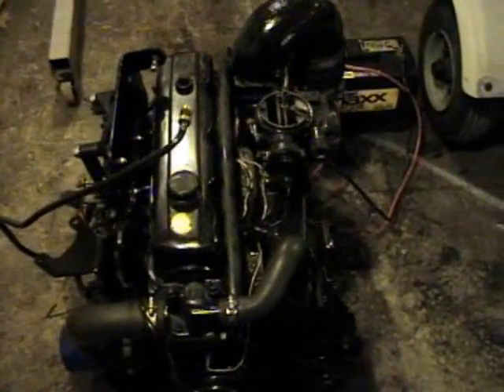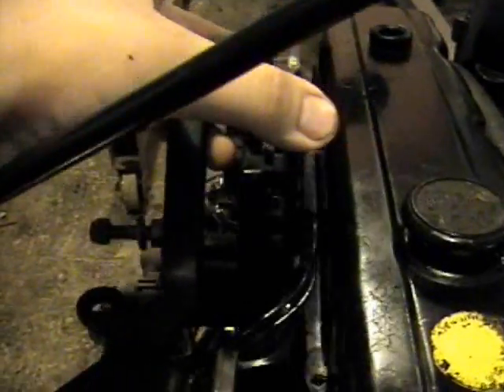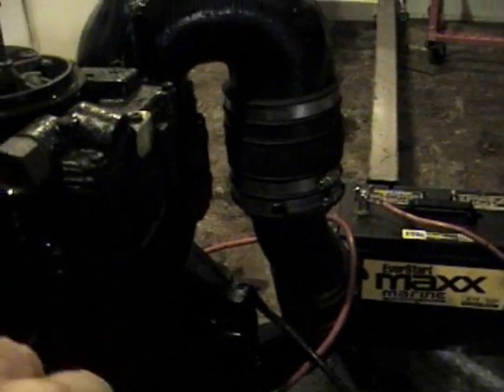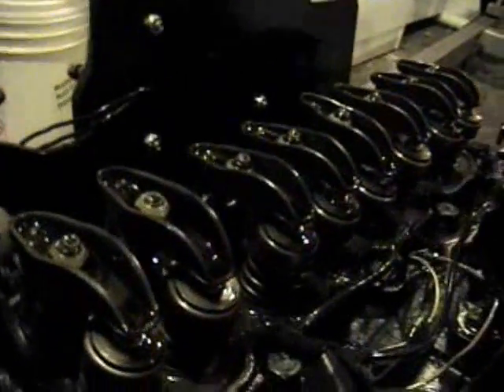With the power of video, here's what I got done: I removed the fuel line from the carburetor, I removed the fuel pump sight line, I loosened the three bolts, and now I'm able to move my bracket just enough out of the way. I also cut a couple of zip ties so I can move this water intake line out of the way just for ease of filming. I went ahead and took off all five valve cover bolts, and now I'm going to lift off the valve cover and reveal my rocker arms.